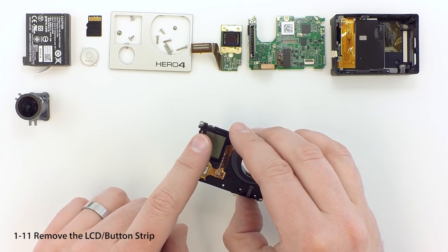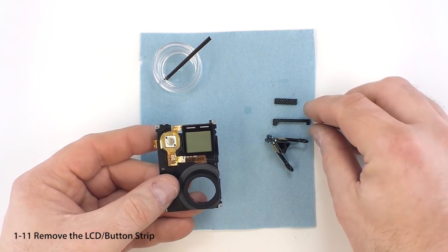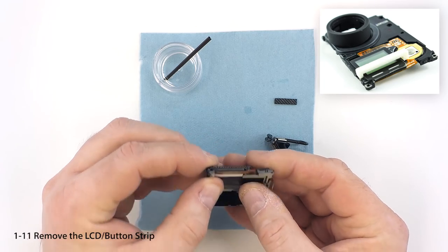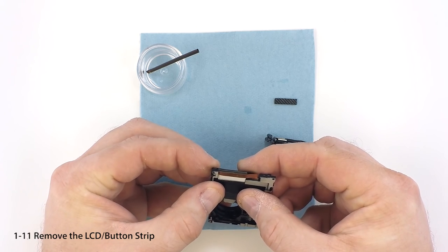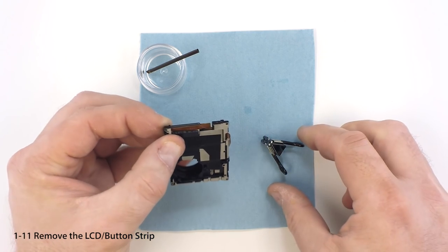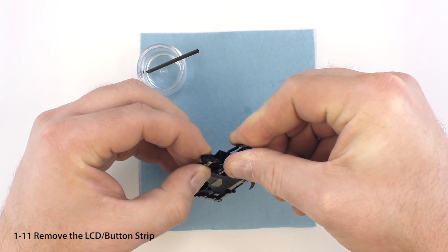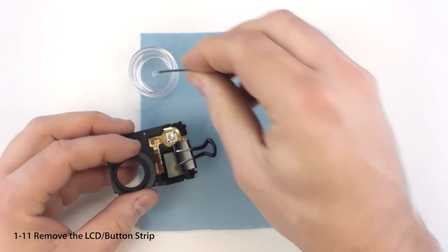Now let's remove the LCD button strip. It's important to note that this is a delicate part, so patience is key during this step — never pry or force this part. We'll need the isopropyl alcohol and a small applicator such as a plastic stir stick. Locate the two plastic parts and the clamp. Note they may also be white or orange. Place the plastic bridge over the left side of the LCD display with the smaller tab at the top edge, as far left as possible while still having both ends touching the aluminum plate. Place a few drops of alcohol on the white LCD backing against the aluminum plate, then place the rectangular plastic part over the white backing. Open the clamp and carefully place it over the plastic parts so there is even pressure and slowly release it. You'll probably notice a small dark patch appear on the LCD — this is normal and will disappear shortly.